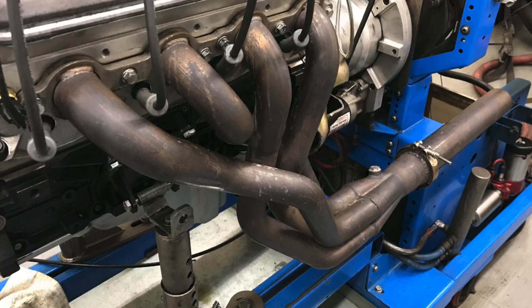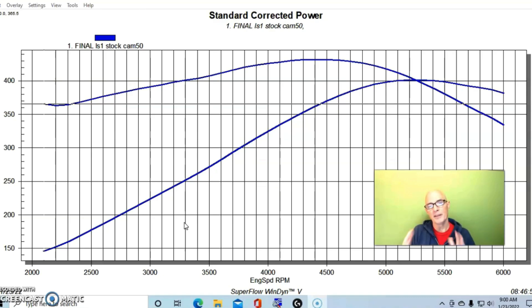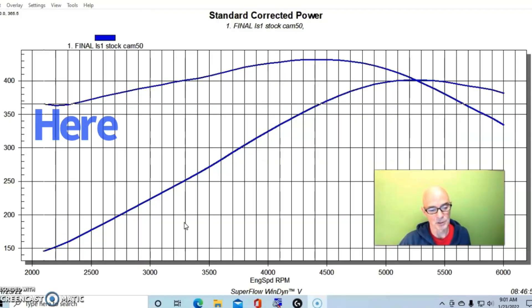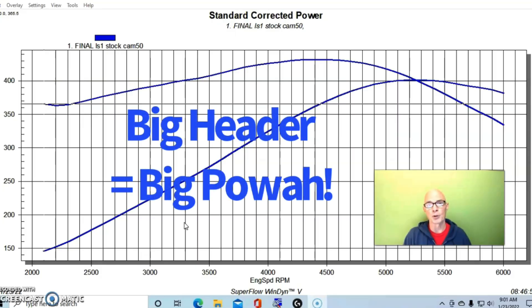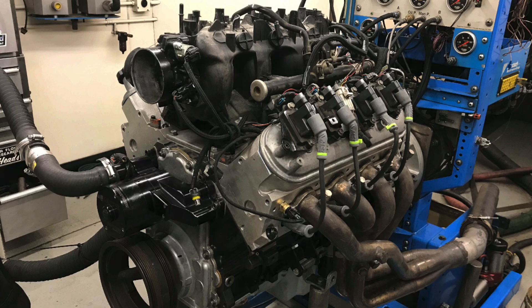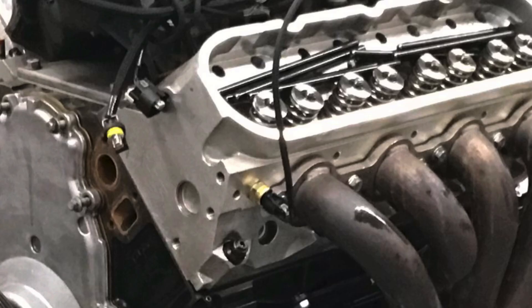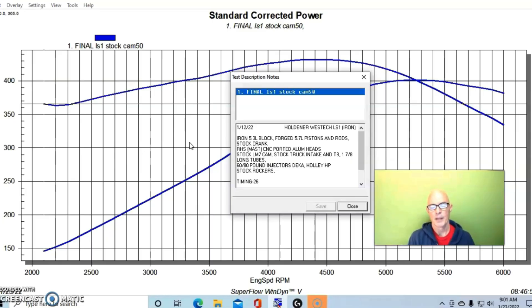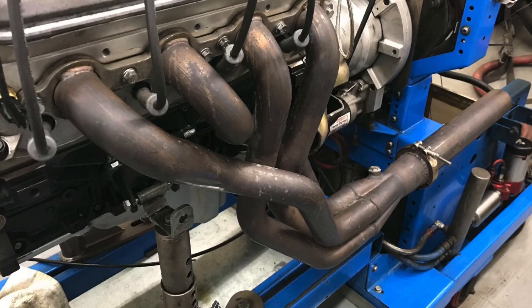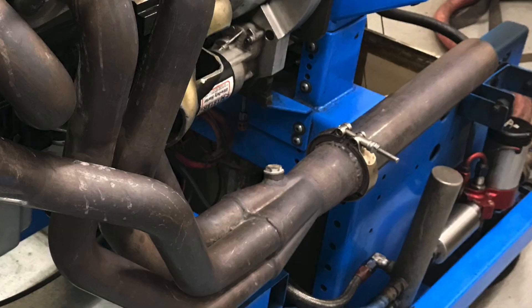We'll take a look at our comparison between 1-7/8 long tube headers and 1-3/4 long tube headers, and the effect of collector length extensions. We're looking specifically at the RPM range down around 2000 to 2500 or maybe 3000, but we'll also see the effect in other parts of the RPM range. A lot of guys will tell you that 1-7/8 headers will make a lot more power and that 1-3/4 will choke your LS — we're going to see if that's actually true. This was a 5.7 liter — an iron block 5.3 bored out to 5.7 — with RHS heads, which were basically ported Mast heads, a stock truck intake manifold, stock truck throttle body, and we started out with 1-7/8 long tube headers from Hooker, swap headers.